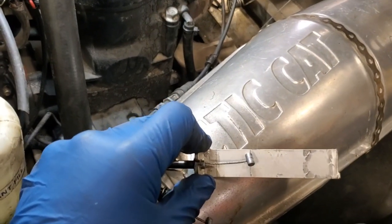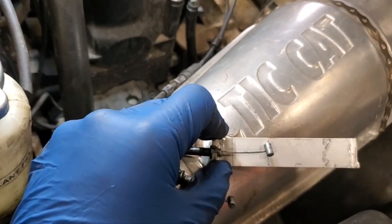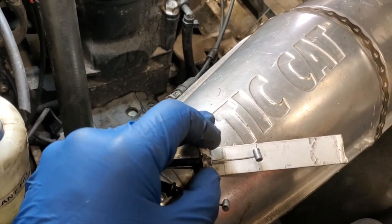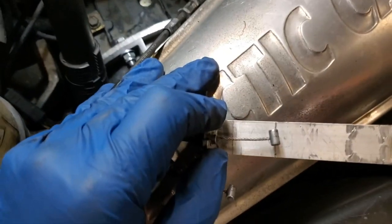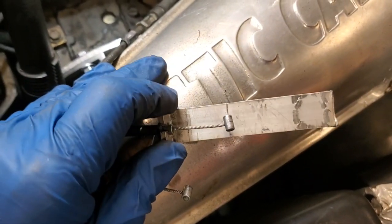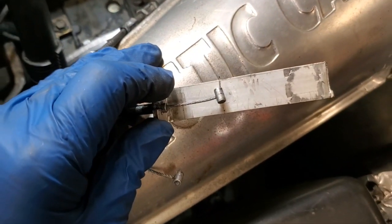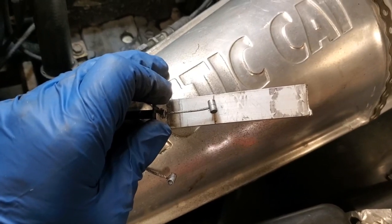All right, so I made myself this little jig here, like I was telling you. So basically, you slide the cable in the top like that. Where the cable exits the sheath right here, that bottom surface, if you measure over that line, I'm at 1.20 inches, which is about halfway in between our tolerance there. So then you can take your cable. I can't do it on camera here, but when you grab a hold of this and take the slop out of it and you eyeball over that line, the bottom surface here would be at 1.20 inches. So that's how I have accomplished doing this the last couple of years here. So it's been pretty good.